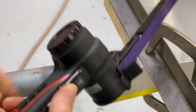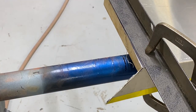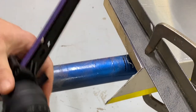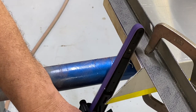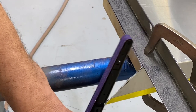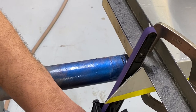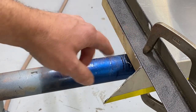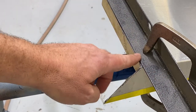This is a little mini belt sander and it works great for filing stuff like this. Now since this is aluminum and the straight edge is steel, it will stop when I hit it — unless I keep bearing on it. It is catching this too, but I don't want to do that. So I'm gonna stop as soon as I hit that edge.